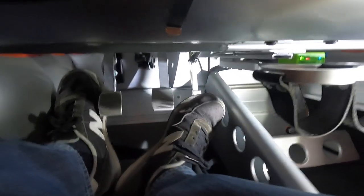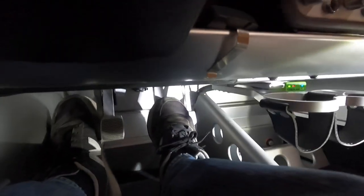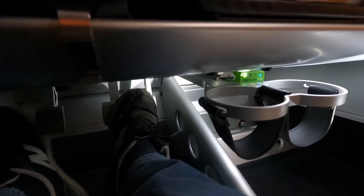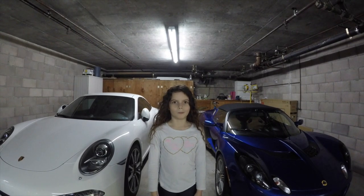And as you can see, now when I am hard on the brakes, the brake is basically right even with the gas pedal and allows me to blip it with the side of my foot there. So now when I'm hard on the brakes, it'll be a lot easier. You can see the brake almost even with the gas pedal there. We're not going to test full throttle with the engine running in the garage - sorry! Happy heel and toeing everyone! Like, comment, share, and subscribe, and don't forget to ring the bell so you can get notified when we post a new video.